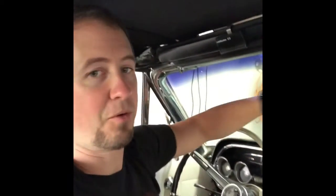And it's great. A couple other notes. Starting out, I was 6 clicks off of firm on both sides, and I thought from there I'd have to soften it up a little bit further. And actually I went 2 more clicks firm and love it right where it is. Having the Ridetechs front and back dialed in, the car really rides and handles great without any other real modifications besides a lower A-arm toe-in stability bar from Bud's Classic Car, and I have a video on that installation as well. And that's just a problem with these 63, 64 Fords and Mercuries. Bad engineering idea that they used.